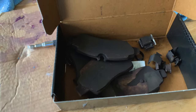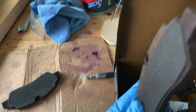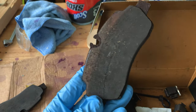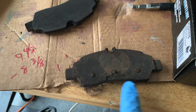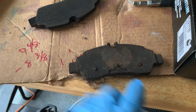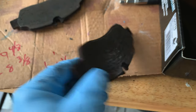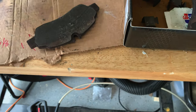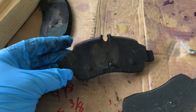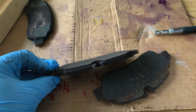I did my first brake change on Monday and you can see here — these are rear pads and I was cutting it pretty close. These are the inside pads here. You can see this little notch that goes into the piston. You can see where the piston was pushing up against this. The inside ones are always the worst. You can see there I was cutting it pretty close, and there's the other inside one — they are getting pretty thin there.